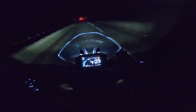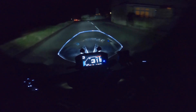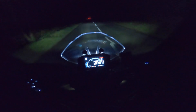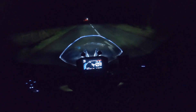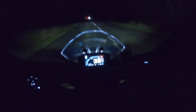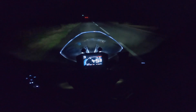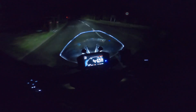I think the big thing to take away from this is get your Torx screwdriver out, adjust the headlight position so you're happy with where it is on the low beam setting in front of you. If you're happy with that, then great. Obviously if you're carrying luggage and doing long trips with a pillion on the back, the headlight might slightly be poking upwards and you might be dazzling drivers coming towards you. So I'd suggest you take a little Torx screwdriver with you. That's something I would recommend.